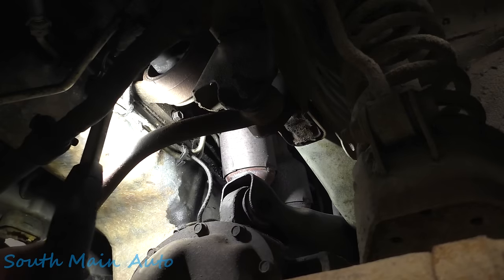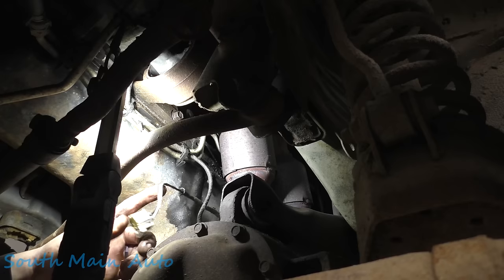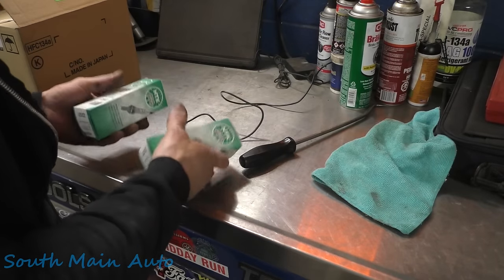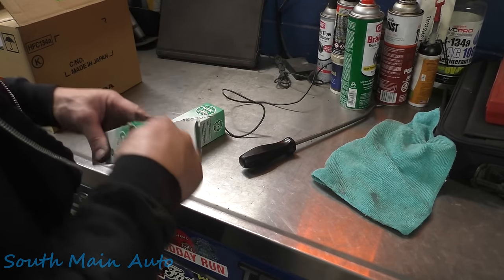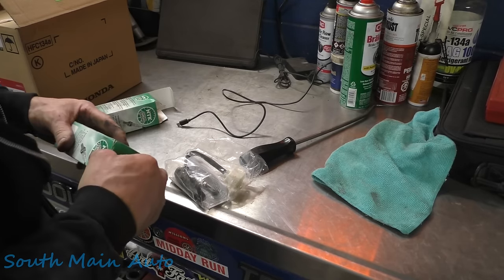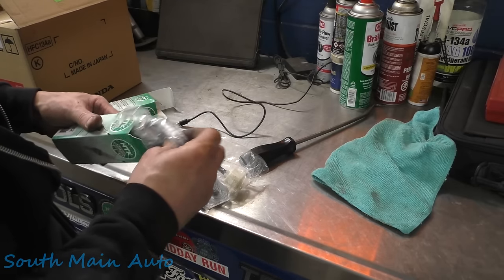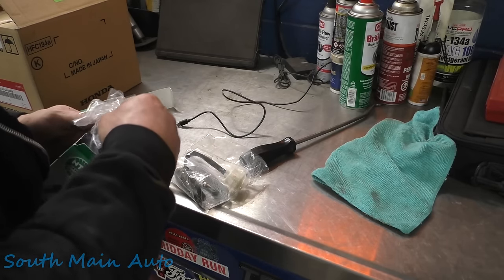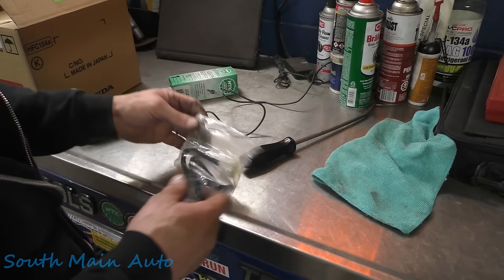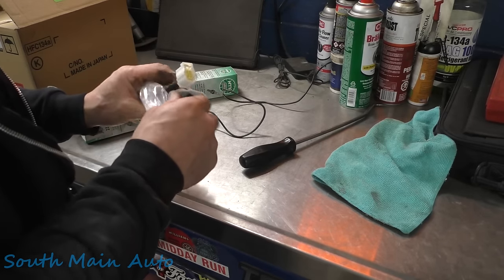We can go under there and actually crack that O2 loose and then run the wires back up. Let's verify we've got the right one first. Should have done that already. Which one feels heavier? This one does. If you're going to use aftermarket sensors on a Chrysler, use NTK. Not a sponsor, but that's who makes the OEM. And don't use the counterfeit NTKs that you get from eBay Motors or Amazon. Use the NTK that you buy at your local brick and mortar store.